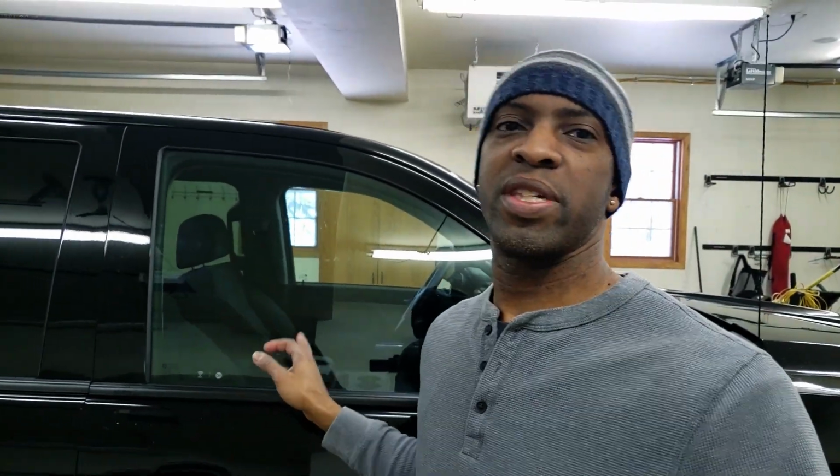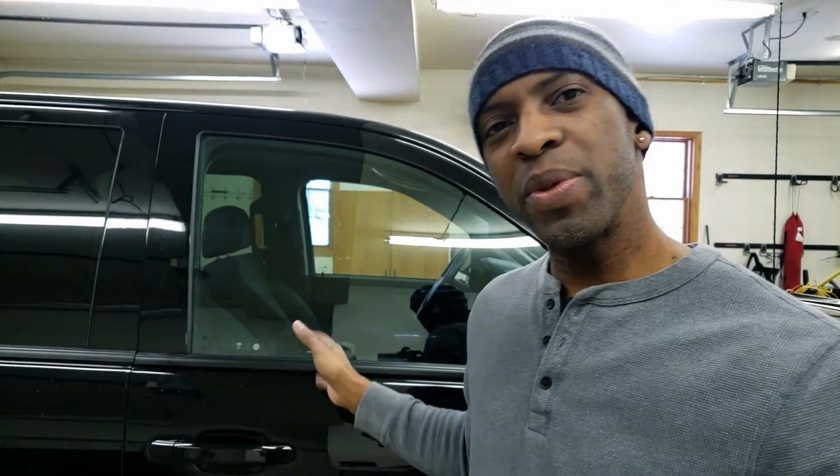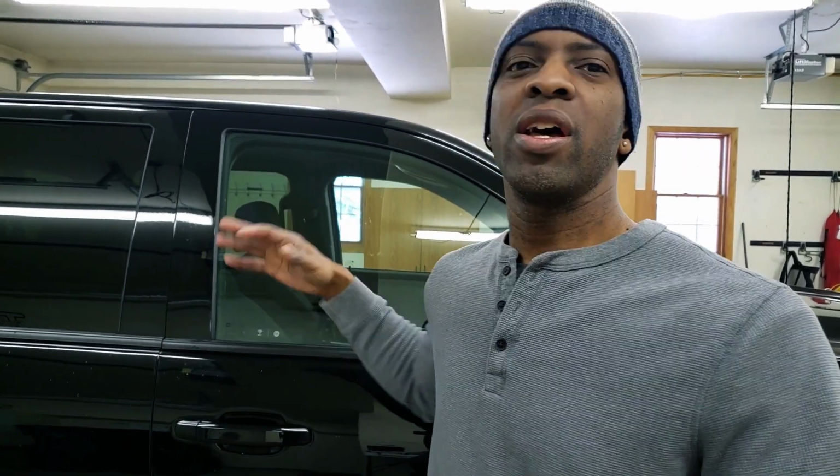Now, we're talking about the side windows. A lot of people will say, hey, you don't need to shrink those side windows, just lay it in. I personally don't pull panels, I personally don't pull seals. I know some of these truck windows you can probably get in without shrinking them, but you know what? It just takes a minute. When I double shrink my film, cut the top edge, take it over to the peel board, it only takes like a minute to just tighten that bottom edge up, so when you lay it in the inside, you won't have any issue with fingers or pulling up trash, any dirt, debris. So let's go into the peel board. I'm gonna show you how to shrink that real quick.